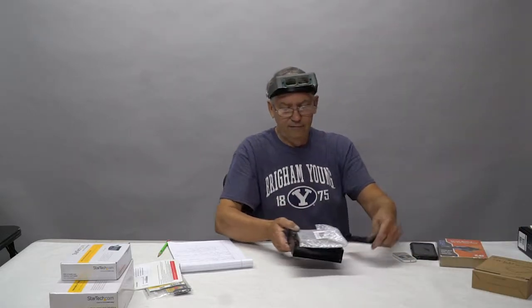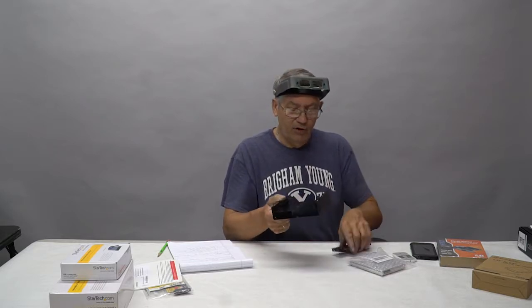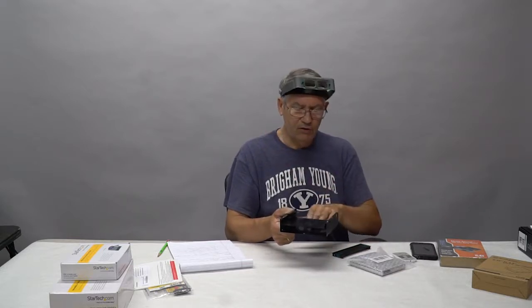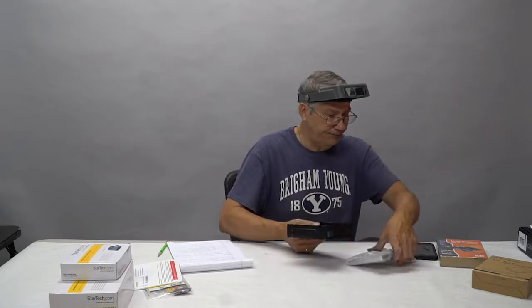Your optical drive. I opted for a slot optical drive reader. This is really cool, this is again made by Silverstone. It's all aluminum. It's just a little slot. So here's your slot optical drive. It's going to go in there. And underneath it, it holds some solid state drives. So I'm going to put your primary image drive, your clone drive in here. The primary image drive is an M.2 and so is the boot drive. They go directly onto the motherboard. And the Western Digital drive will be down below in a vibration isolated carrier. So this is your slot drive, really clean.